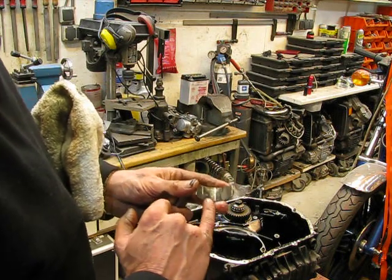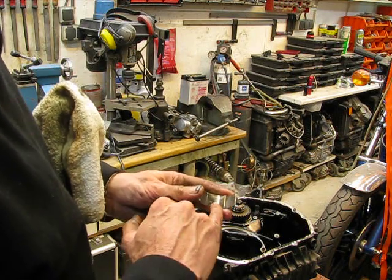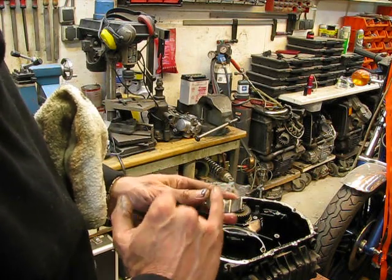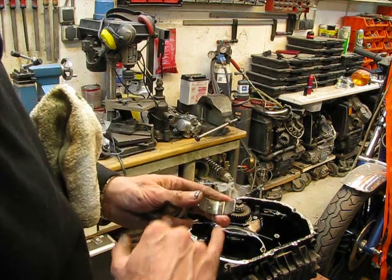Let me explain more. I can see lines, grooves, polishing — that is the hardened material. And you have to stop there. You have to replace those bearings now. If you go further it will damage your crankshaft or more.